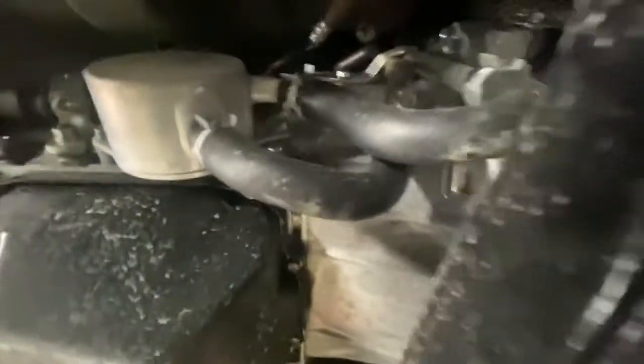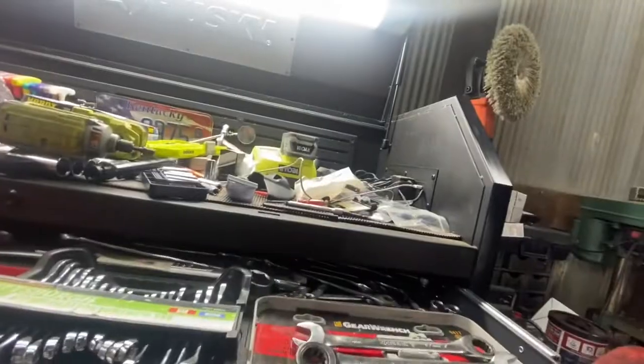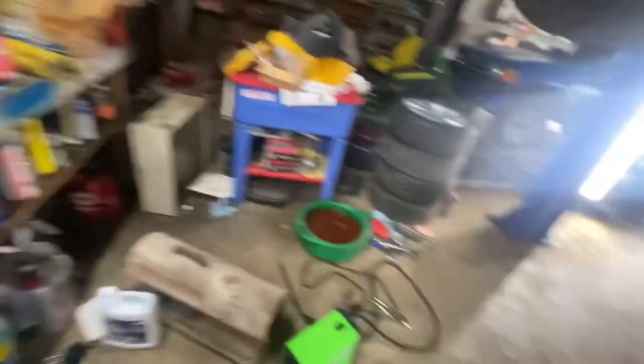So a little more detail. There's the warmer we're talking about. Here is the sandwich plate without the thermostat that I was referring to. There are three bolts — one there, two here, one there — that sandwich the plate and warmer to the transmission, so they're rather long. They look to be 12-millimeter; I had them in my head as 10-millimeter. Obviously I had forgotten.